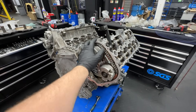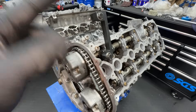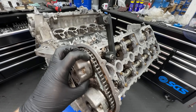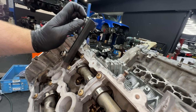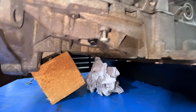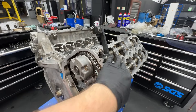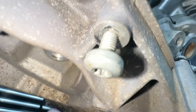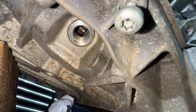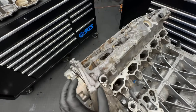Okay guys, so I've done the timing, turned the engine, and as you can tell this is not good. When I was cleaning the camshaft adjuster, unfortunately one of them didn't lock up. So while I was turning it, the camshaft adjuster was turning until it locked up, then the camshaft went with it. The result is we are basically a full camshaft adjuster angle out. I already put the crankshaft pin back in place. The other side is fine, but we have to redo bank one, which is cylinders one to five. Now you can see the crankshaft is in position and the camshafts are nicely lining up on both sides, so we can continue with the covers.